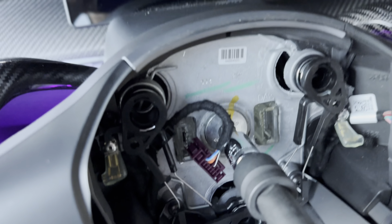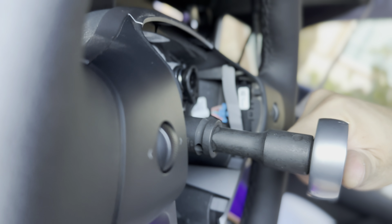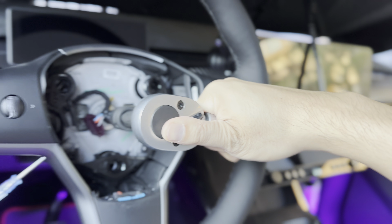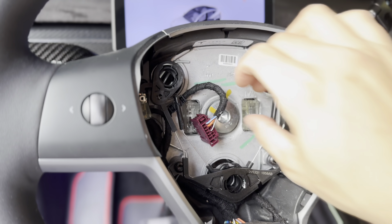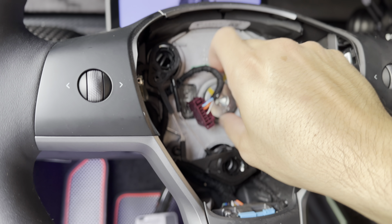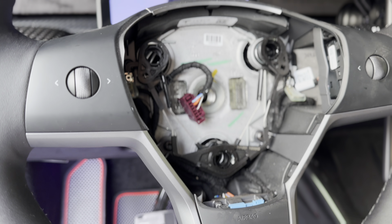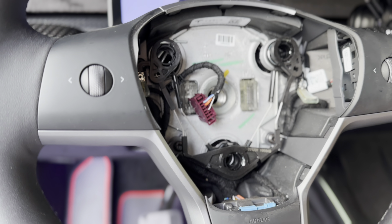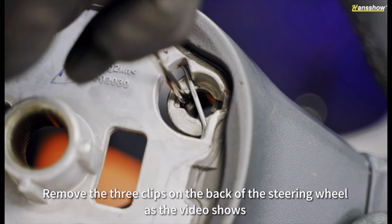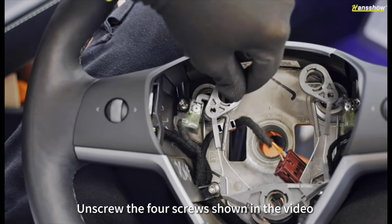Have an extension — you want to be about an inch or a couple of inches away from the wheel. Go ahead and turn it counterclockwise. Once you break the 10 millimeter bolt, use your fingers and unscrew it. Place the bolt somewhere safe and the wheel will come right off. After you take the wheel out, pop these clips on the back — there are three of them.